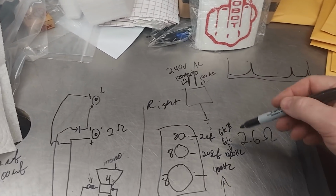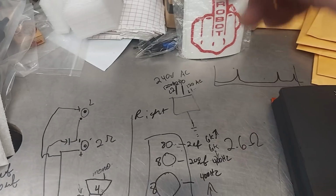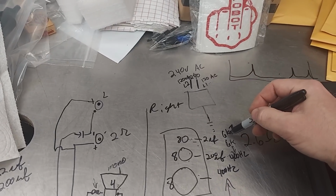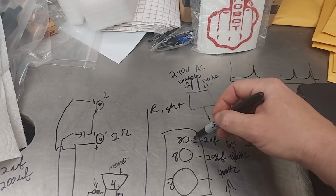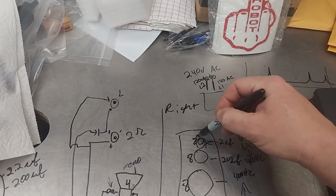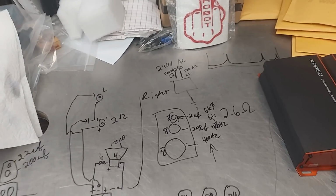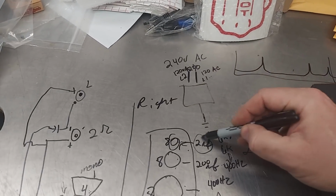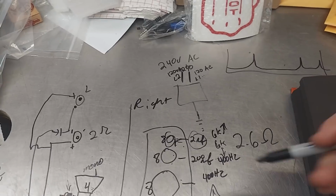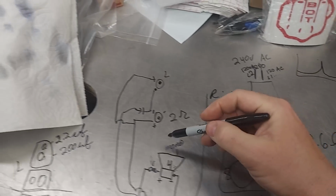They resonate at a certain frequency as long as that impedance is a certain impedance, and then outside of that, it destroys it. So if you go about 6 dB per octave, anything below like 3K is going to be diminished greatly by this tweeter. This tweeter is not going to play below 3K. It would require lots and lots of voltage to overcome that if this 2 microfarad capacitor was in series, filtering out all that bass. And that's why they call the 100 microfarad caps bass blockers, because that's what it does. It blocks the bass.